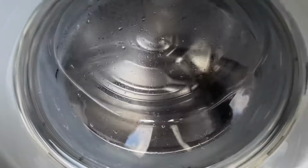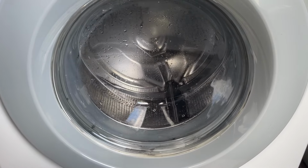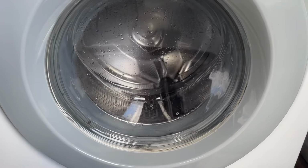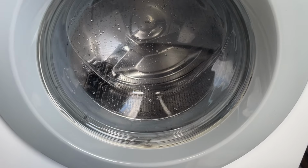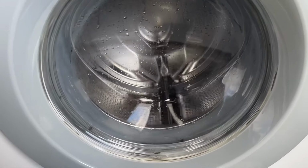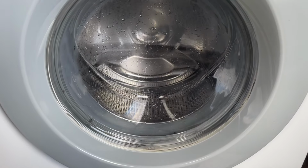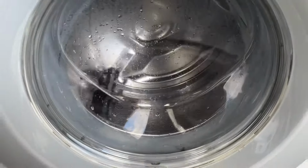I think it makes a wee bit of a weird noise, but I've noticed that the weird noise it's making is actually from the motor. Whenever I put the belt on, I got a bit concerned because I was like, gosh, is the bearings actually going already? And then I ended up taking the belt off and it sounded perfectly silent. So it did, so it's a bit weird.